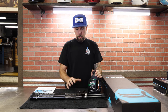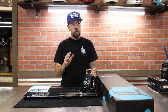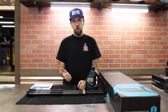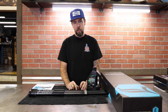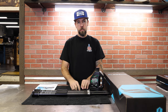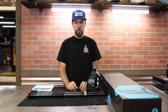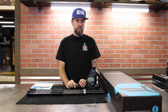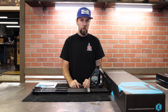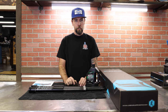Some of you might be asking what's the difference between this kit and what's in your stock forks? To put it simply, a stock fork, a traditional setup fork, has really three things inside of it: a spring, fork oil, and a damper rod with a certain amount of holes of a certain size. The rebound and compression of that fork is controlled by the oil flowing through those holes at a certain rate and slowing it down. It's kind of an old school way of doing things — it's cheap for manufacturing, there are less parts, but ultimately that means for anybody who wants to make their bike handle well or great, you just can't do much with it. There's no adjustability to that setup.